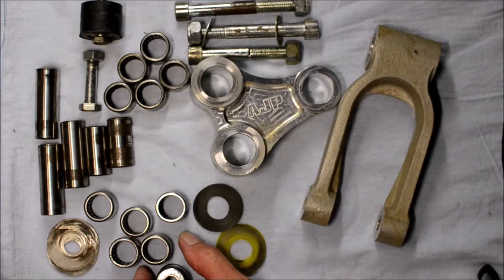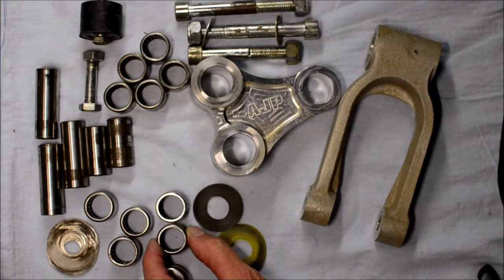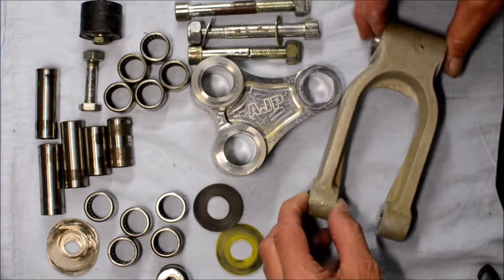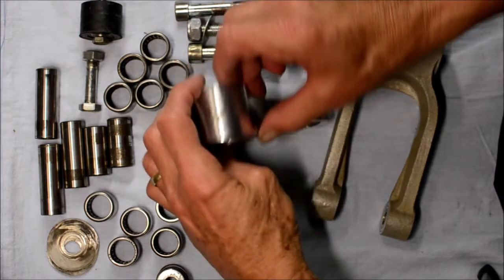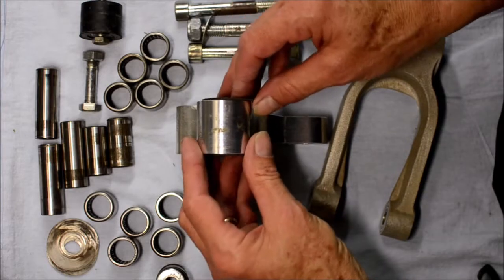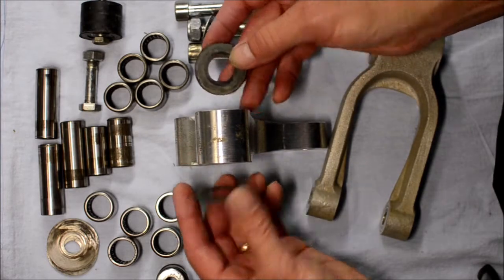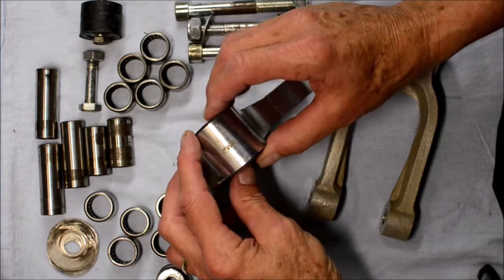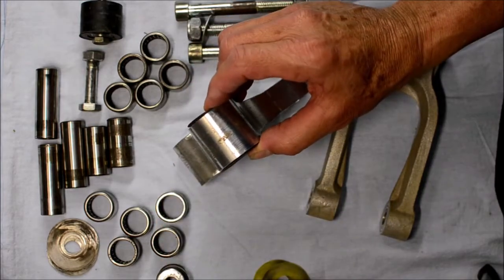Time to talk wear and tear. The swinging arm has got 10 of these bearings involved in the rear suspension — four across the swinging arm, two in here, and two in the front of the fork. The fork is centered by a couple of these; the factory ones have a millimeter of clearance either side. These are half-millimeter nylon spacers of some sort; they go up under the swinging arm so the link is secured at the top.